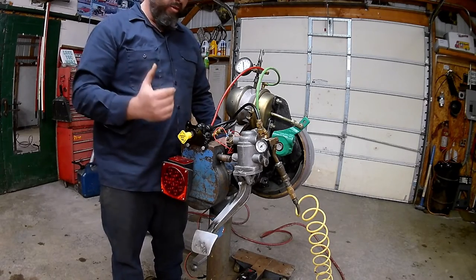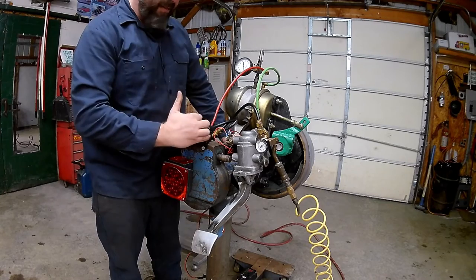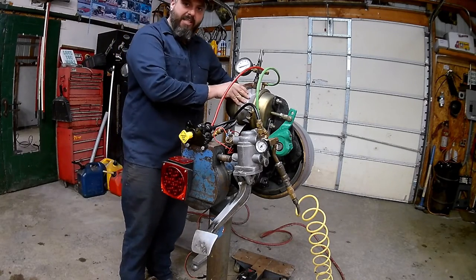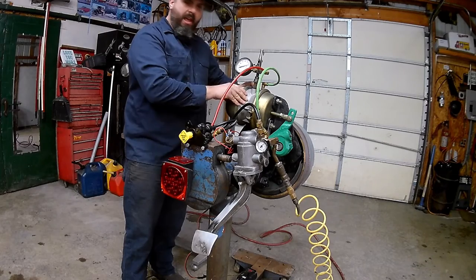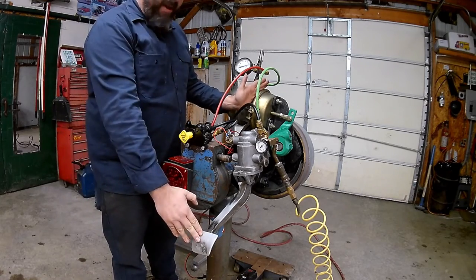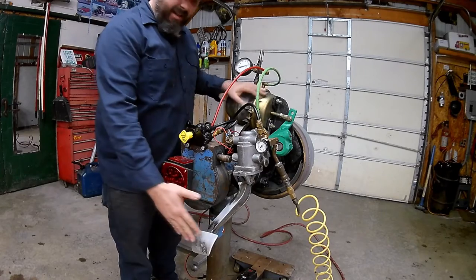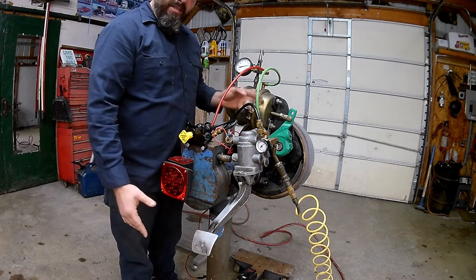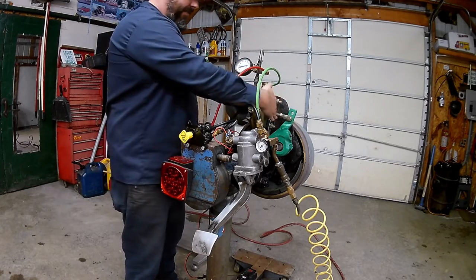It's very important that we maintain that air pressure inside the tank. Back to the basics — we push in our push-pull valve, PP1, releasing our brakes, which just collapses the spring in the back side of our brake chamber. Now ready to move the vehicle, there's always air going into that chamber. The other side of the brake chamber works every time we step on the brake pedal — we apply air, the rod goes out. We let go and a spring inside helps push it back, and springs on the brake shoes pull everything back.